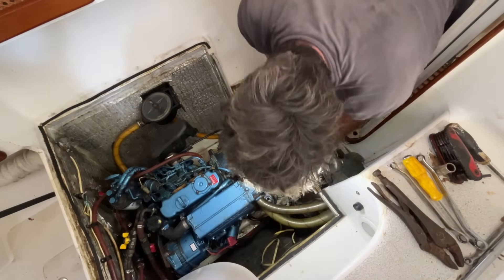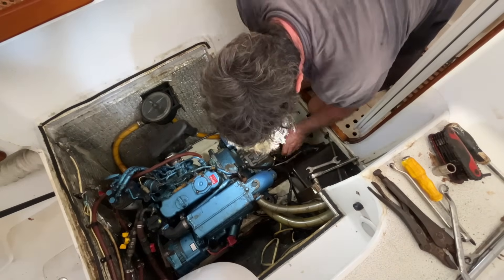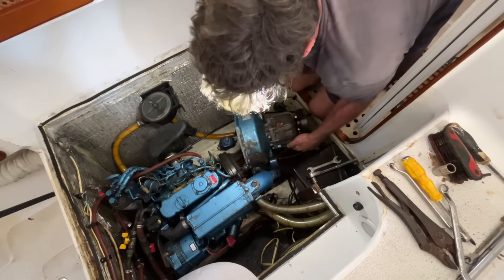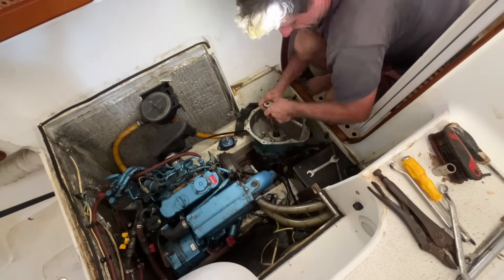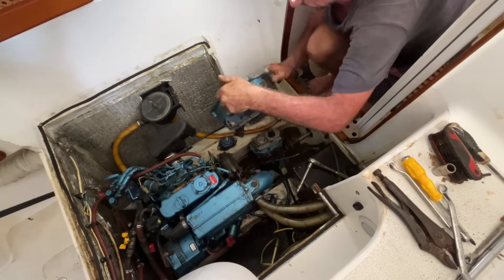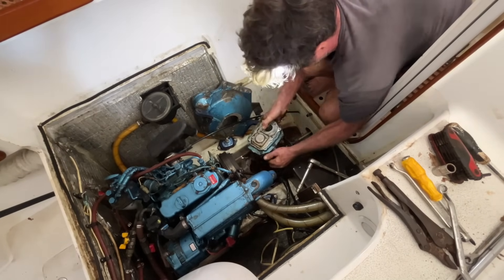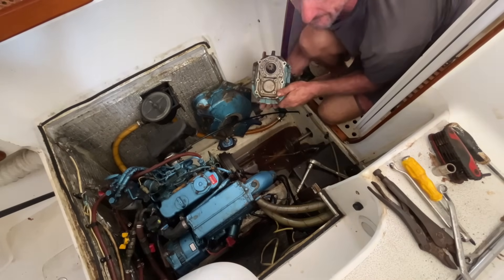The engine mounts are quite flexible as you can see, so the front ones I didn't even undo - I just bent them up on the rubbers basically. They're only going to sit there for three or four hours. Moment of truth - all the bolts are undone and the gearbox just slips backwards off its spline, pretty easy. Then it's just a matter of undoing the six bolts holding the bell housing to the gearbox, pop that off, and you're left with the gearbox itself. Very easy - there we have it, just a cute little thing.